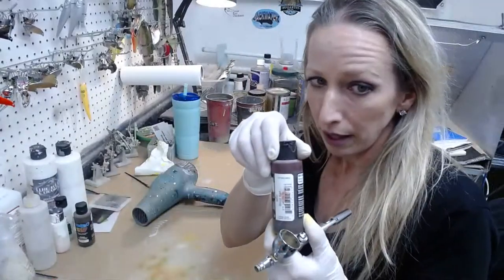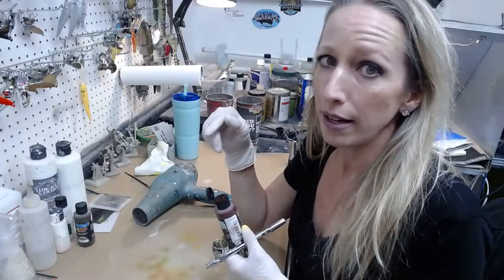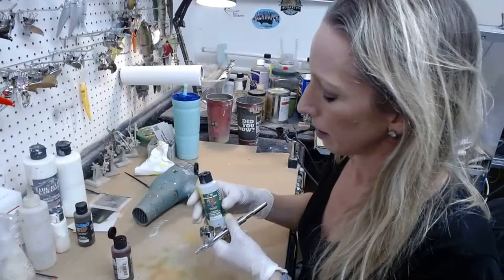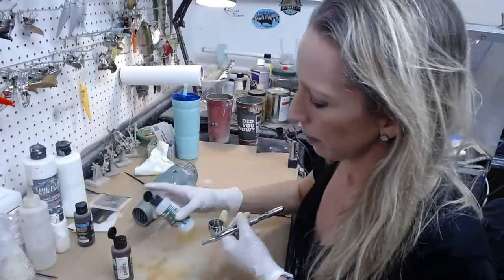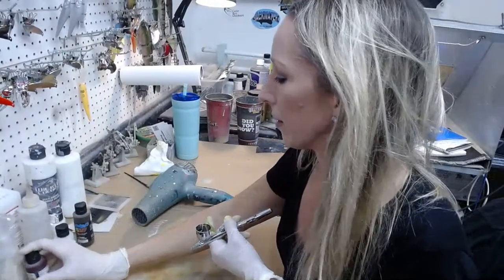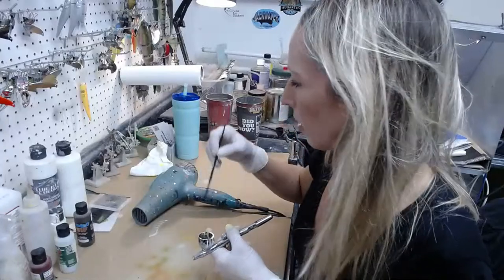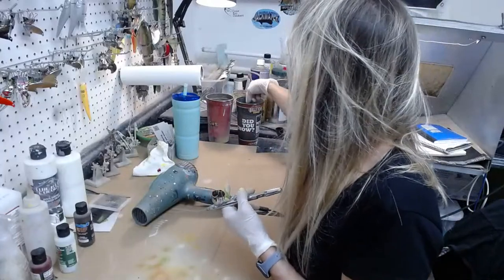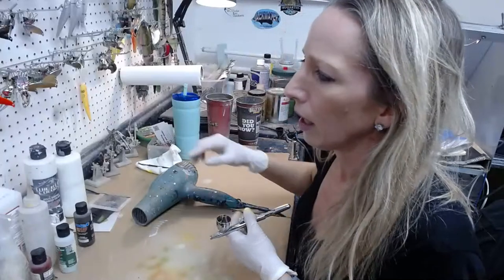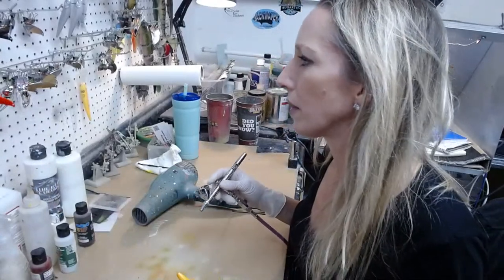This is Blood Red Candy. I'm going to do one of these with blood red on the bottom. The blood red is a candy color — I'm going to put the 4030 balancing clear in first so the blood red paint doesn't pull to the bottom. Blind Symmetry is saying one-to-one ratio for 4030, then a top coat of 4040 bleed checker. I don't do that — I just go straight half and half and I don't do a bleed checker. You can put a coat of 4004 transparent base on top if you're worried about bleeding, but I don't usually have problems with that.